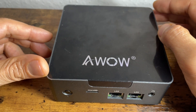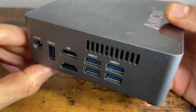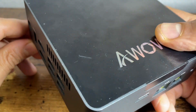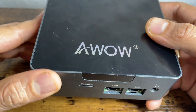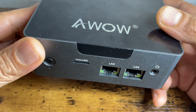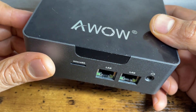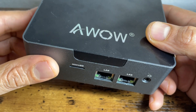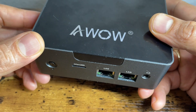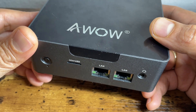Afterwards I also set it up as a NAS device and, as you can see it has many slots, connecting multiple external hard drives made things easier and it worked very nicely. At the end I switched from NAS to PFSense because I wanted to use its 2 LAN ports for firewall functionality. With PFSense I initially noticed some lagging and internet interruptions, possibly due to the Realtek network card, but I could get a maximum of 700 Mbps throughput which I think is quite good for this kind of device.